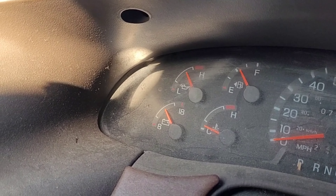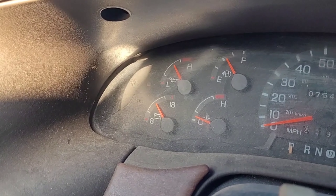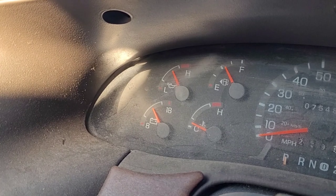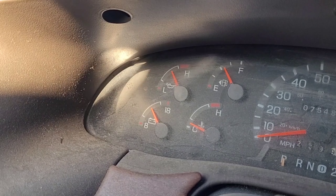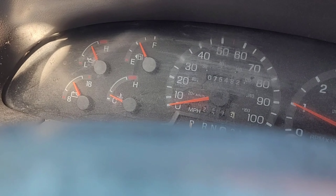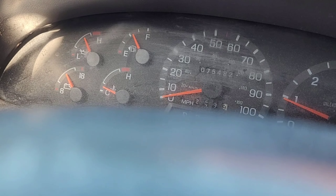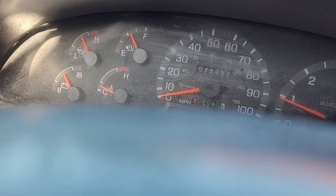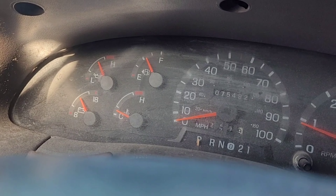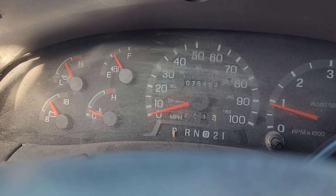If you see that little oil warning light, that's normal at the beginning — it's just warning you that there's no oil pressure yet. That's because we took all the oil out and just put new oil in. Let the engine idle for a little bit so the fluids circulate, then check it again to make sure all the levels are still good.